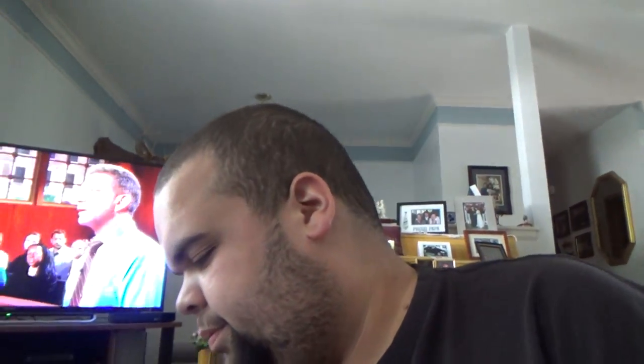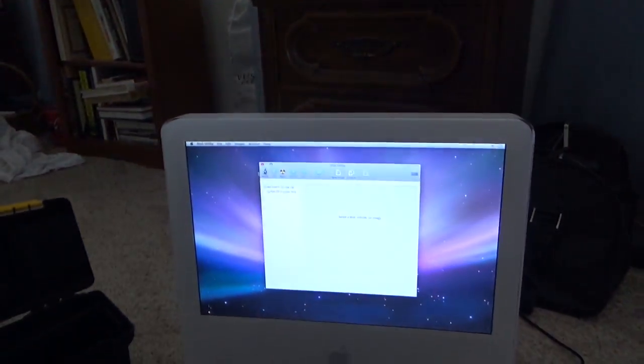I just need to get a SATA cable for the iMac G5 and it should work fine. I'm going to leave the 750GB drive in there — 160GB would be pointless these days. That's what you get dealing with people on Craigslist. I'll eject the CD, and I'll eventually make an updated video once it's fixed. The hard drive is in there, it just has a bad SATA cable — with a bad cable the system can't see the drive to install software. Thanks for watching, see you in the next video.